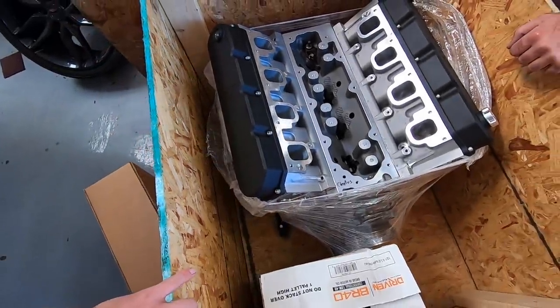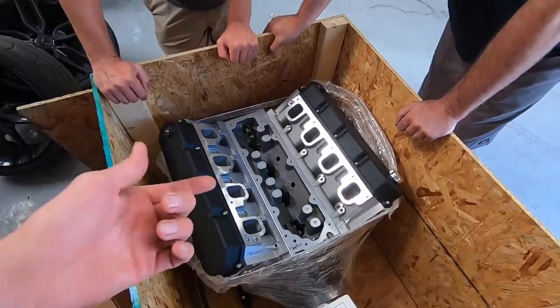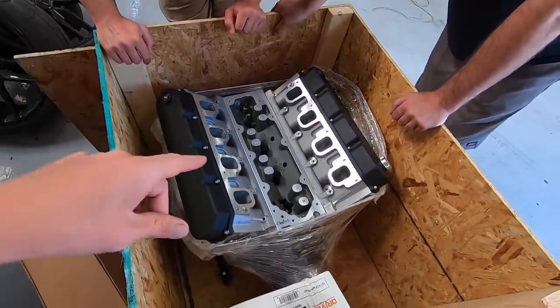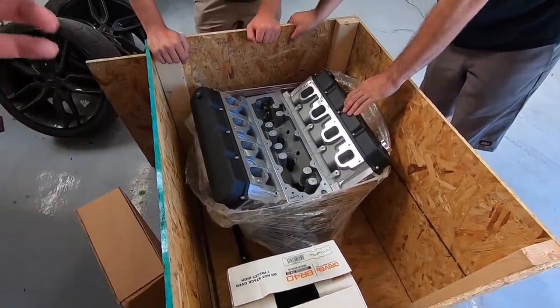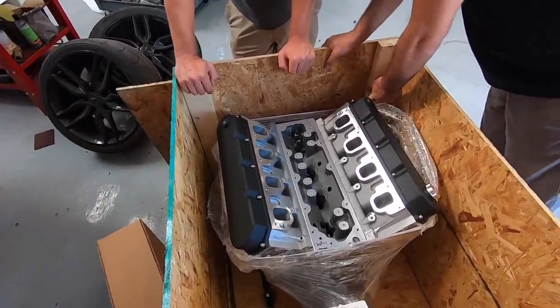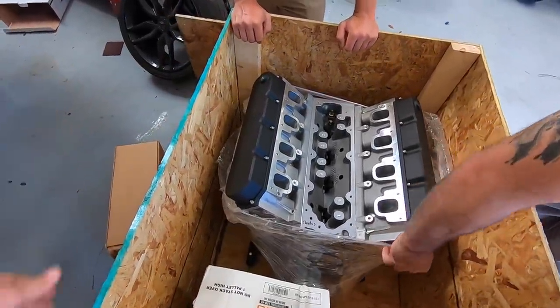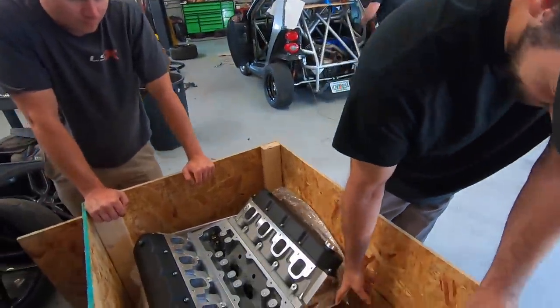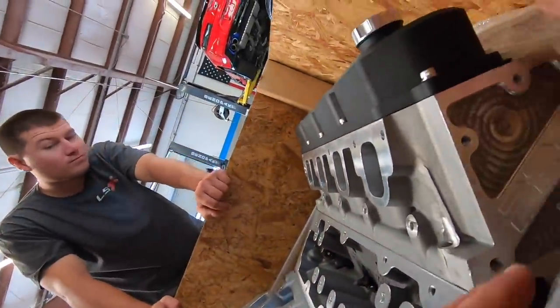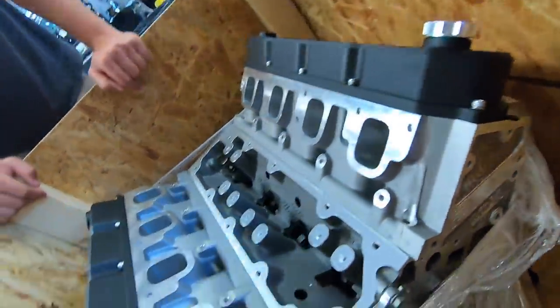No DOD — obviously. This engine is rated for about 1,200 horsepower given the I-beam rods. We're gonna rest a little bit around the 1,050 mark, but the engine can certainly handle more if we want to spray it. Look at the front of these heads — PRC LTX. They don't have an LT6 bolt-pattern block yet, but our boys at Texas Speed, when they do their own castings, said, 'You know what, we're gonna make our own six-bolt heads.'